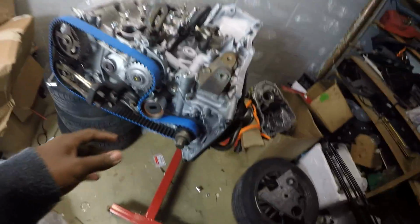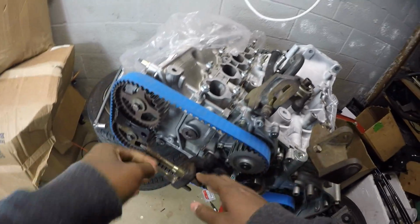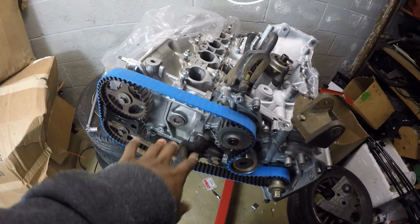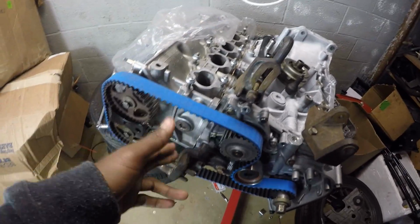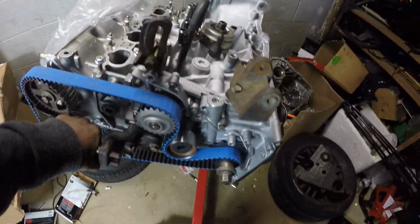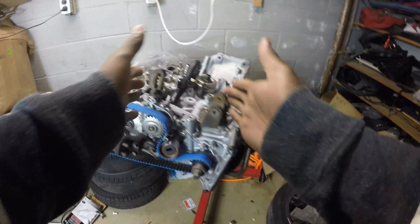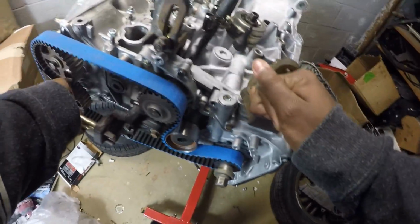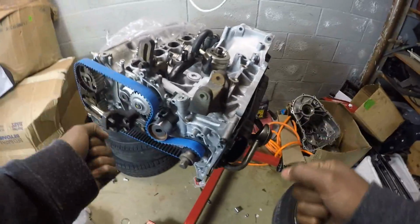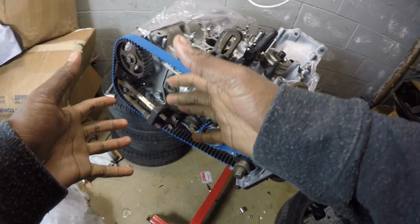But besides that, the timing belt was on, and I was getting ready to put the motor mount on, which is on right now, and torqued down to 40 foot-pounds. So this is good to go. And what happened was, the motor was up straight, and I was trying to torque it, and I felt the whole entire engine stand kind of lift. It was lifting as I was trying to torque it, and I was going really slow with it. It was just starting to tip.